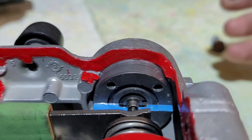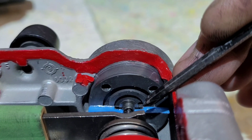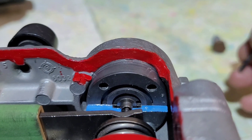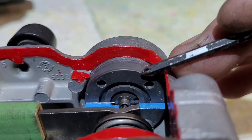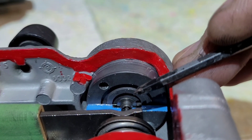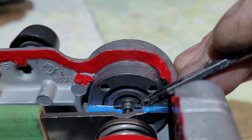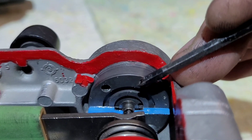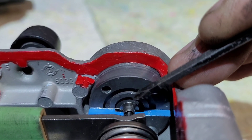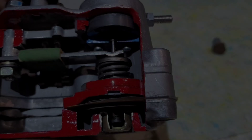Here's a close-up of the business end. That's our metal disc — very thin and very flexible. We have this outer line which is just the cut-in-half sealing area. In this section, fuel comes and goes: we've got one orifice there going out and one directly underneath. The one underneath is the same height as this part, which means if you've got full fuel pressure on there it will seal it off completely.